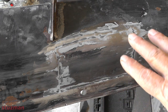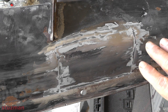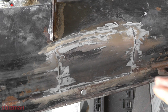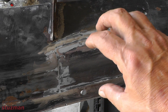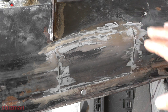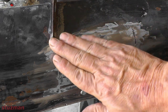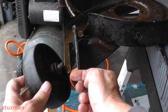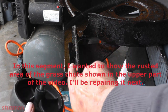Okay, the patch is in. I had a little problem holding and clamping it because it wanted to move and I was trying to keep everything flush. So what I decided to do is I got some high strength JB Weld and put a little bit in, and I had some duct tape behind the back here to hold it in place. Then when I put the patch in, I put a little bit of JB Weld in and let it sit for two days. Then I came back and tack welded it to hold it in place. It's holding up pretty good and it is flush across the top, the sides, and the bottom. You'll notice there is a washer — the washer will go here and then it will go to the third hole up.